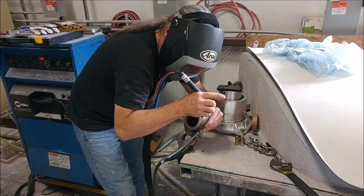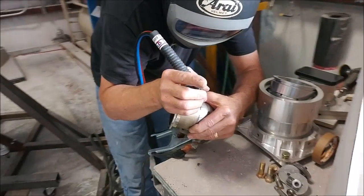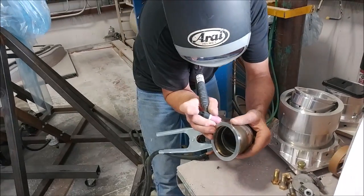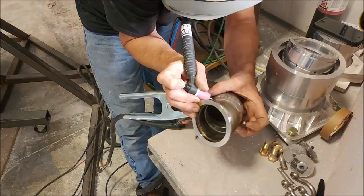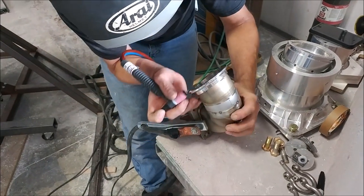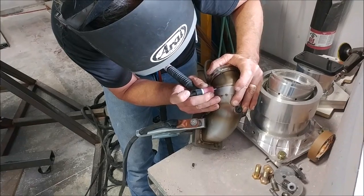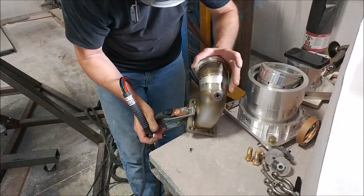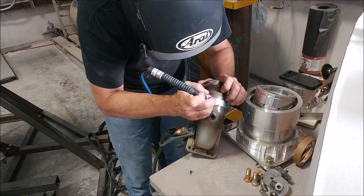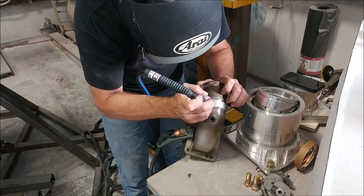Welcome back. As usual, this week was busy with a bunch of different things going on. Britt came into the shop to tack together this last pipe because we had to insert a little bit of extra pipe that goes between turbo 1 and turbo 2. When I squashed that pipe to make the rectangle shape it shortened the radius a little bit, so we put a little more section in there — and that's going to work out for us. He's tacked that up and taken it away to be welded.